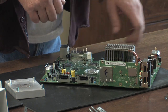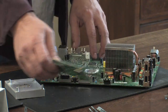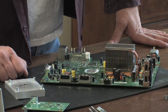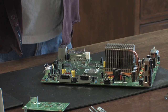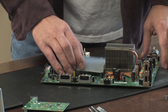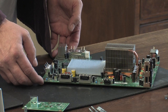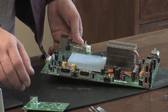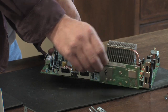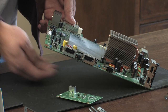Then unplug the power, unplug the video cables, take the on-button off, and let it sit for maybe ten seconds or so. Take your heat sink, put it in the holes for the motherboard, and then you're going to want to lift up on the motherboard on the opposite side from the power switch so that the legs actually protrude through the bottom of the motherboard.